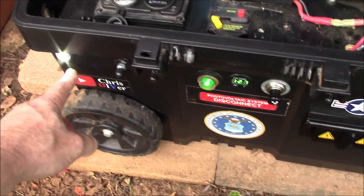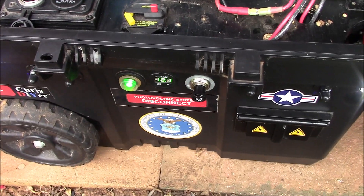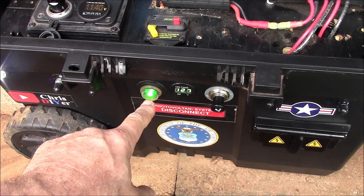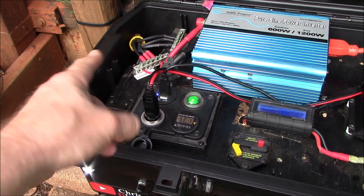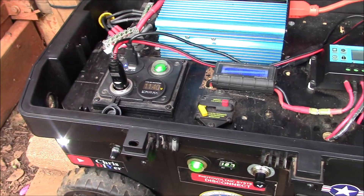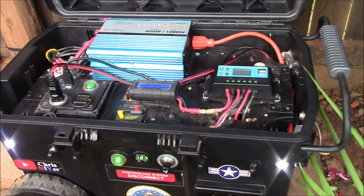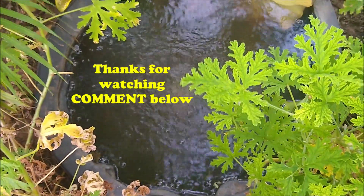The other thing is I wired these marker lights to the switch using piggybacks — that's not a good idea. I'm going to rewire them onto the buses here. It's the same circuit, so the switch will still turn off the lights and everything else. Just a couple of things I learned that I wanted to share with you.